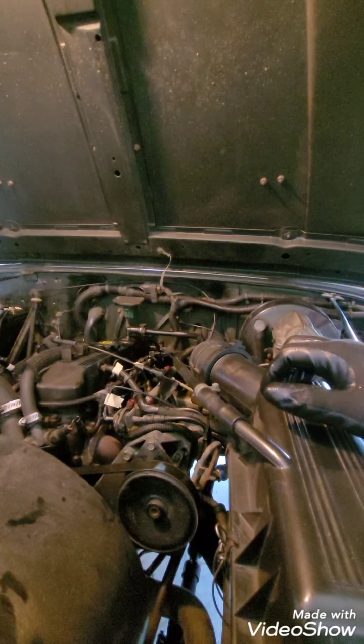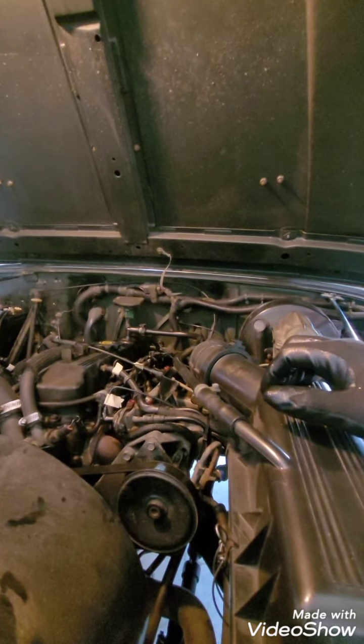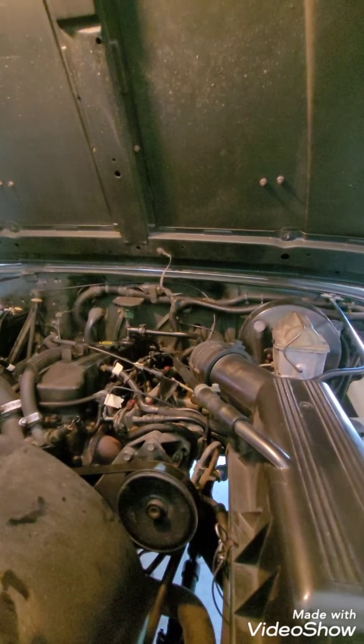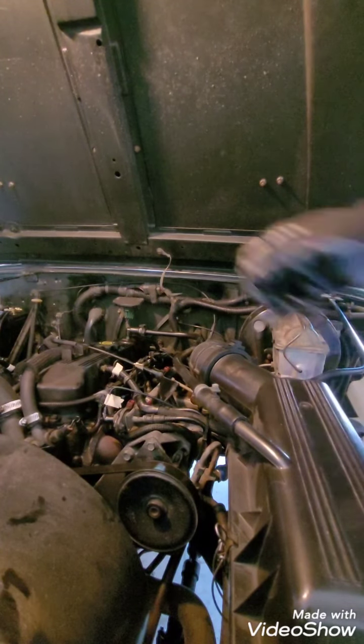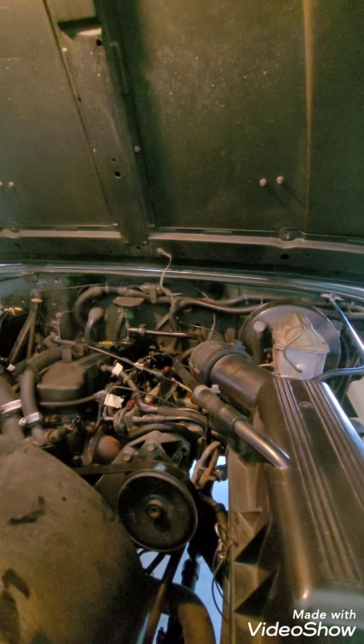So I ran a diagnostic, and I didn't film it for some reason, but I took the tester and went to each one of them, and they are all running out of spec. The spec on the 1995 Jeep YJ is 14.5 ohms at each one. Every one of the first three fuel injectors was running 18 ohms, and the fourth one was running 2.3.